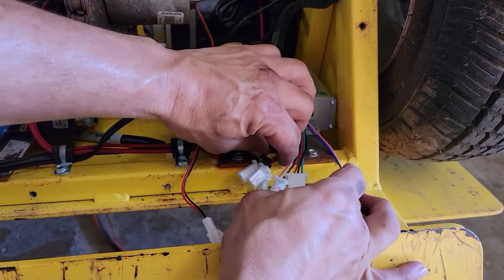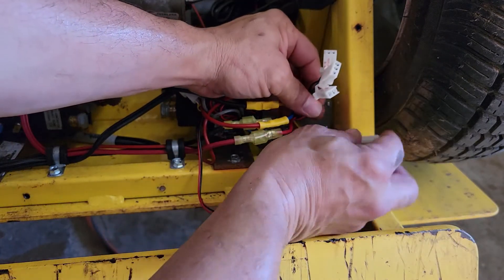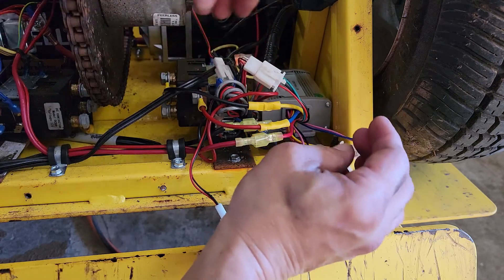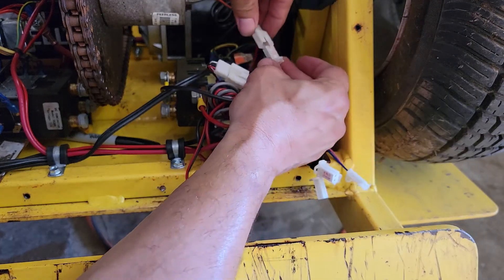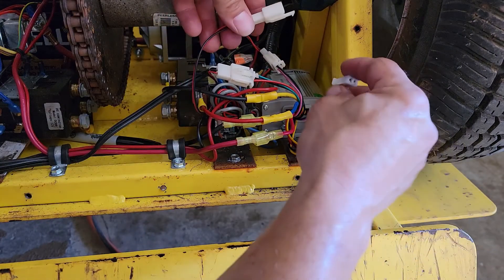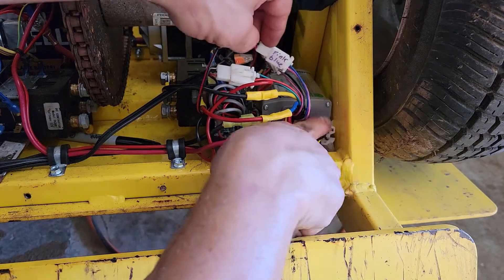The last step is to hook up these small gauge wires with white connectors. You'll see a bundle of three wires zip tied together — these are not used, don't hook these to anything. The other three are the ones we want. The easiest one to do first is the three-wire clip. Then we have our pink and black — clip that in here. Don't force these; if they don't want to go in, one of the connectors might be bent. Then this one is labeled pink and blue, so we hook it up to the pink and blue wire and tuck it down in there.